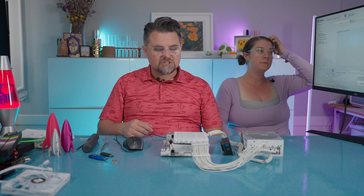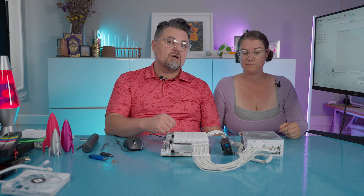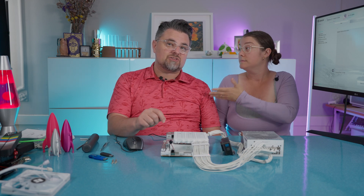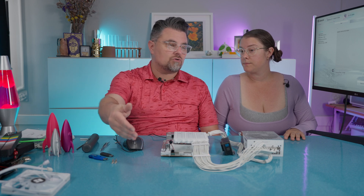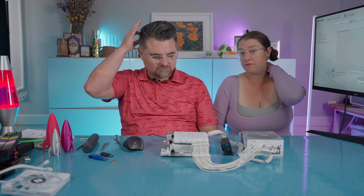It's also helpful because you can have a previous version and roll back easier. Sometimes you might find that your memory doesn't work with a particular BIOS, or you might read a news report saying there's a bug or vulnerability with your particular BIOS and you want to roll back. With these 9800X3Ds, there have been problems with the chips burning out and some versions of the BIOS have had problems, so being able to roll back or update forwards has been really beneficial.